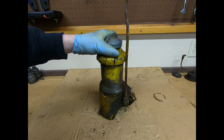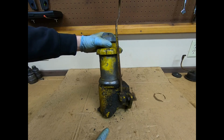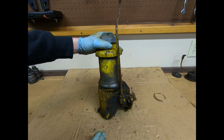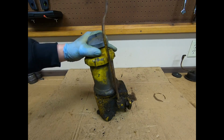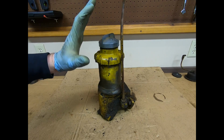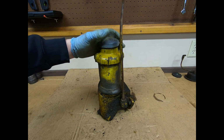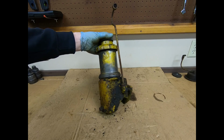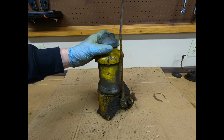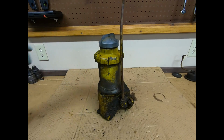This was used on tractors 5J1 through 5J1227. Now, considering that 1938 production ended at tractor number 5J1262, that means only the last 35 units produced in 1938 did not have this original style breather. So this is, like I said, a hallmark indicator of an early first model year D2 right here. It's kind of special just because of that.